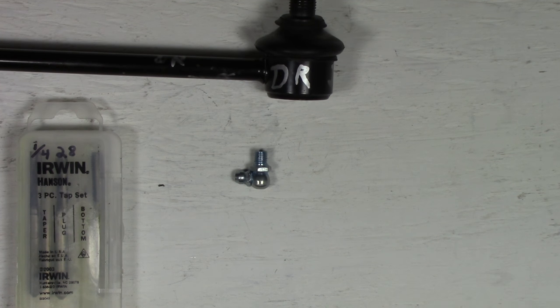All right, there we are down to the 7/32 drill bit hole. Now we're ready to tap it. I'm gonna use my bottom tap. I'm gonna put it in the drill press up above, press it down and hand turn it. I'm disabling the drill so it cannot be turned on, turning it by hand.